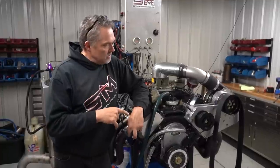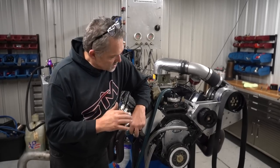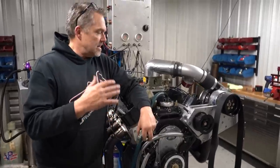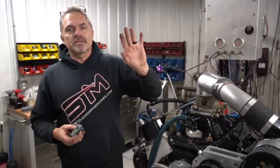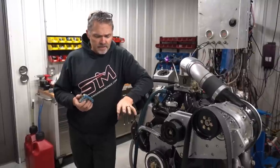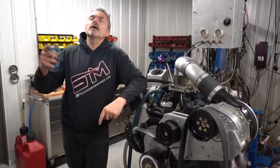We're slowing down the blower because on the first pull, it made 20 pounds of boost, which is just too much boost for this old girl. This thing still just has a multi-layer steel gasket on it and a single needle and seat carburetor. So it's like, oh, wait a minute, this is probably the wrong pulley combination. It's been so long, I don't remember everything about it, what we had on for pulley combination. And then I found an extra pulley that he had sitting in a box for it. I go, oh yeah, I remember.